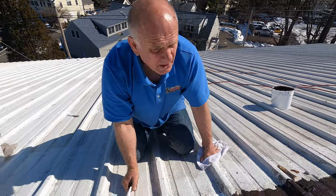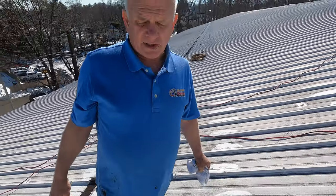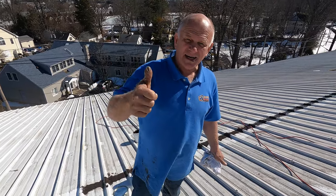You can see we use Super Silicon Seal on this whole roof — look at the screws, Super Silicon Seal everywhere, we dab it. You can do the same with Turbo Poly Seal on every screw, but I suggest you paint it with a silver coating either way. Both are good — you'll never regret it. Now here's the secret: preparation. We took off all the other junk — caulking, silicone, latex — the seams are exposed, we have bare metal around the screws and seams. We don't leave anything. That's the secret, and then you can do a good job. I'm the flat roof doctor — I know a thing or two.